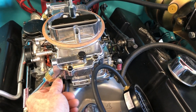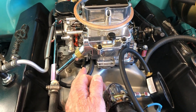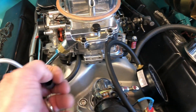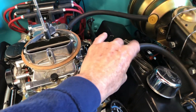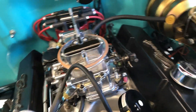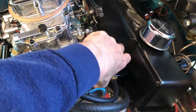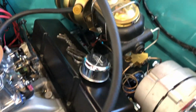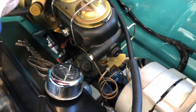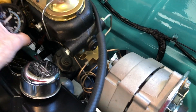When you're monitoring vacuum, you've got to use full manifold vacuum, which on this carburetor is going to come off of this port. I don't want to lose that little plug — I'll stick it in my pocket. So what I'm going to do is hook up this hose, which I found in my hose boxes. I'll set this over here so it doesn't get wrapped up in the alternator or the belt.